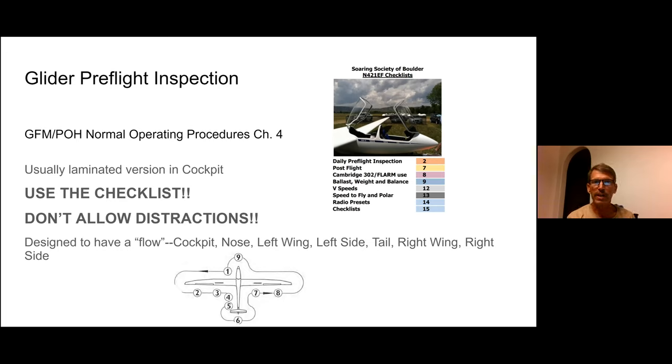So you pull the release and nothing happens. Again, with that Schweizer mechanism, depending upon where the tow line is, it could cause it to fail because it kind of locks the release from working properly. But with the Tost, it's probably just something plumb wore out, a spring broke or something like that. A lack of tension. Yeah, again, that's more of the Schweizer than the Tost. I think the Tost, even with slack, will release. It just has to have any pressure whatsoever on it.